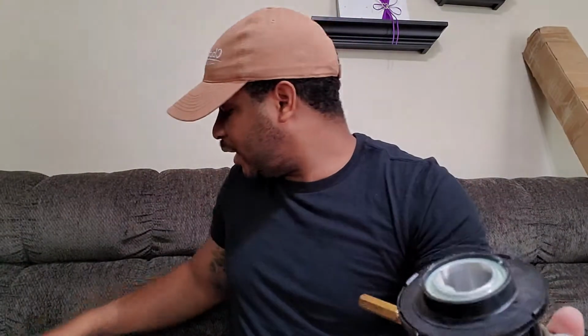Alright. Now this has to be the, these look like duct tape for this. I want to say this is the, freaking, brain fart. Slave cylinder. There we go. Golly. Alright. It's safe in there. So yeah. Slave cylinder. Hydraulic slave cylinder. So to bleed this, you need this part and this, which comes with the fittings and stuff that you put in here to get it to bleed and stuff.